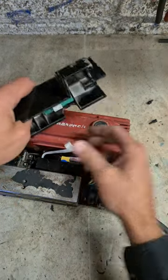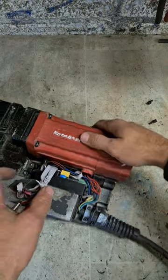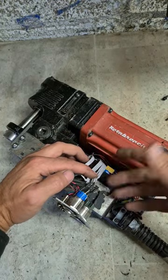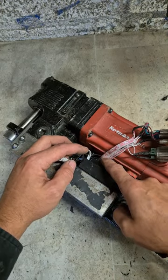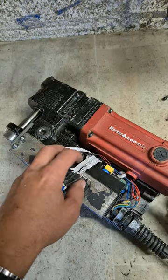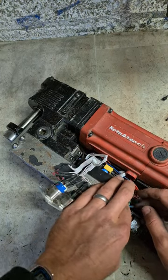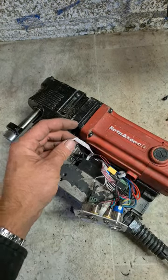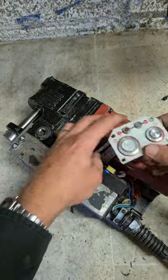Fiddly jobs like this I really hate — if you get it wrong you're going to blow something. It's on a wiring loom with a ribbon connector, and all white wires. Even if you got a breakdown diagram for this, it's still just going to say white wire to everything. Any marking indicators would just be from the factory — nobody's going to have anything on them. So I'm going to have the main live, motor, neutral, magnet. These are just voltage overload protectors on these small strips — they're not going to be anything. Controller's not burnt, fuse is okay, so I imagine it's going to be this wiring.